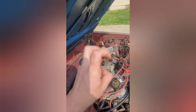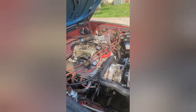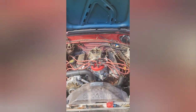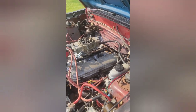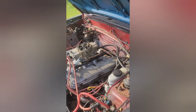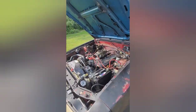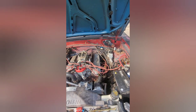Get rid of the harness you made, throw everything back to factory, and be able to put it back to stock — without ruining the car for the diehard fuel injection, stock Fox body restoration guys. This car has a bad ignition switch on it, so we just went to toggle switches. But you can make it where everything comes on with the key. Toggle switches on something like this — this is just a track beater, it needs a lot of work, and he just wants something to have fun with and tinker with. For something like this, toggle switches are nice.